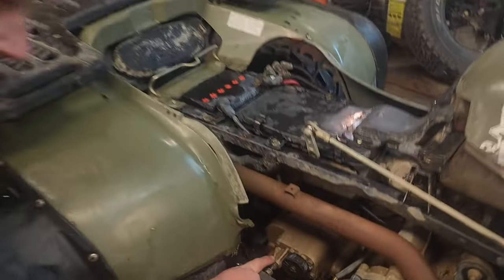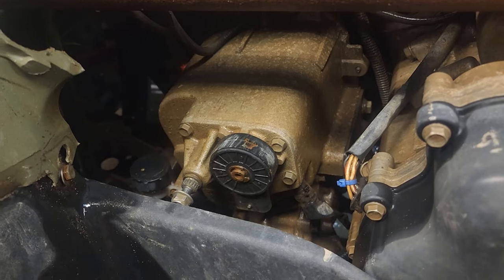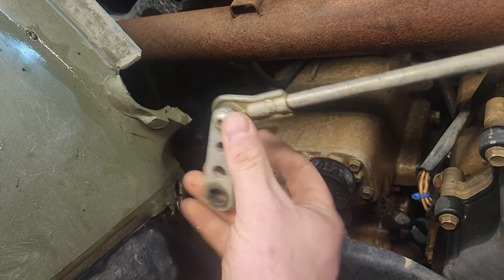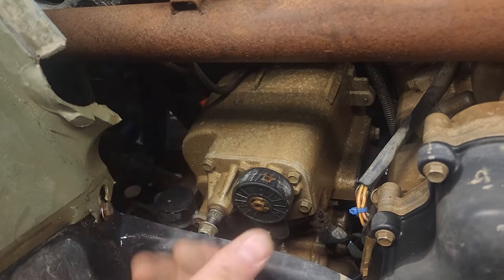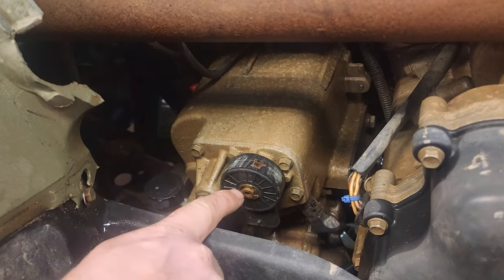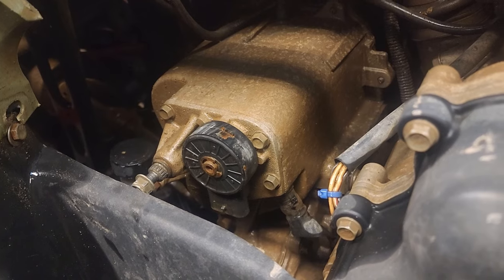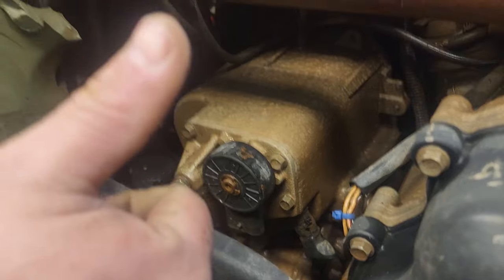So this is the plate in question here. This is your gear sensor, the plugs on the bottom, and this is your shifter input shaft. And we've already taken this off. This just has several splines on it that it uses to do the things with the thing. So we've got to pull this off. It looks like there's four 10 millimeter bolts around the corners. I'm hoping we don't have to pull the sensor off, but there's almost no way that sensor isn't going to have to come off. Wait 1 minute and we'll be right back with the plate off.